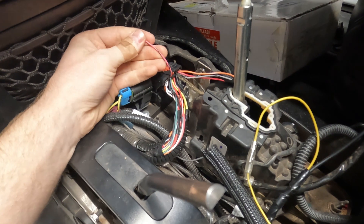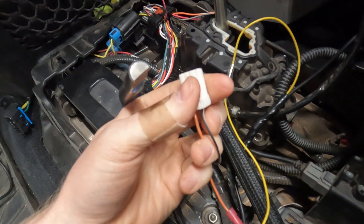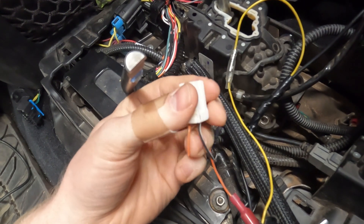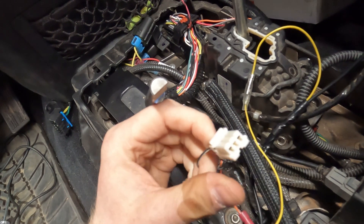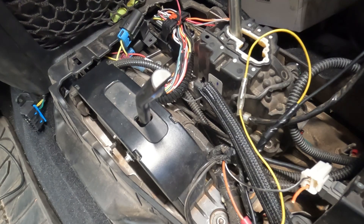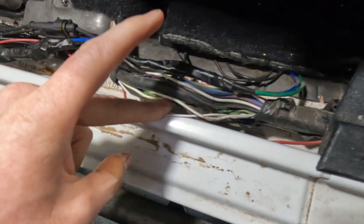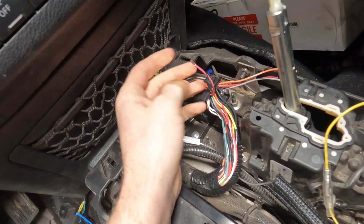I was able to add power to input 12 and it was dimming the actual shifter. The only issue is when you try to use the wires that came from the lights that activate when you turn on the lights for the NAG1 shifter — when you dim them too much, it lowers the voltage to where it doesn't get activated, or it's not enough voltage to activate the switch in the PCS software. The only wire I was able to find that is a constant 12 volts when the lights are turned on is for the tail lights in the rear on my Jeep, which is a 2013 JK Rubicon — one of the tail light wires is a white with a purple tracer. So what we need to do is run this wire, tap into it, bring it up here, and wire it into digital input number 12.